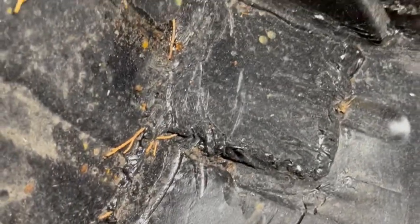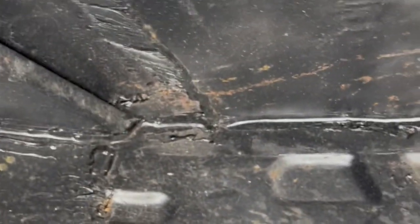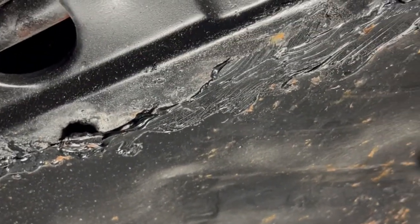You don't have that shape on the other side. Anyway, it's had a plate welded in the floor just here. It's had a plate welded on the inner sill just here. And also — that looks like a floor pan out of something else — so that would have to be cut out and redone. It's also got a plate there. You'd have a load of wind noise coming in with that big hole. Following it up — that doesn't look original. Looks like it's got a Z-shape pressed in — it's supposed to have like three lines. So I don't know what's going on there.